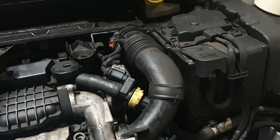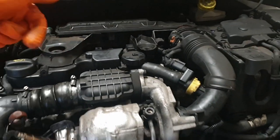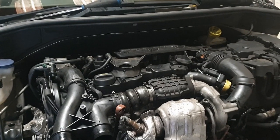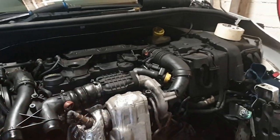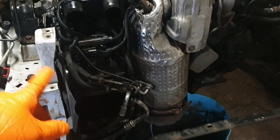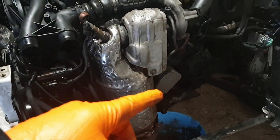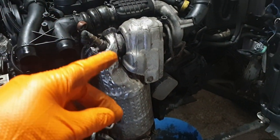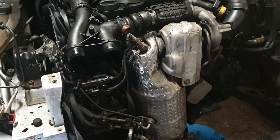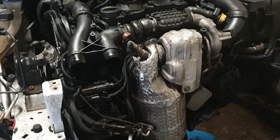There's one nut which holds the DPF block on the back of the engine. I want to put that on. And then, yeah, headlights, radiator and bottom bar thing, intercooler. Connect those up, put coolant in it, bleed the coolant system, do oil and filter, crash bar, front bumper, wheel arch liners, wheels, done, out the door. Yay!